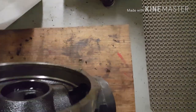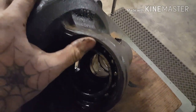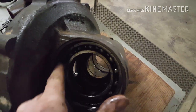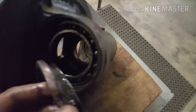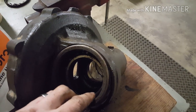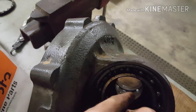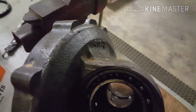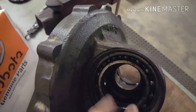Once you've got this piece off, take it to the bench. You'll have a seal up in there that's steel on the outside. I sprayed a little bit of WD-40 around the edge of that seal — it was corroded and rusted in there. Just pry it out, but don't pry around the edge of the thin wall. Try prying in this area where it's thicker, right here towards the seal, because you don't want to scrape up this surface. Pry it out on that edge of the seal and get it out, then clean it all up.